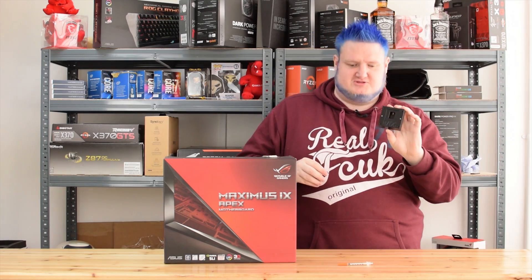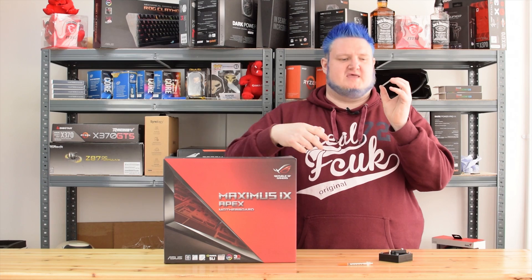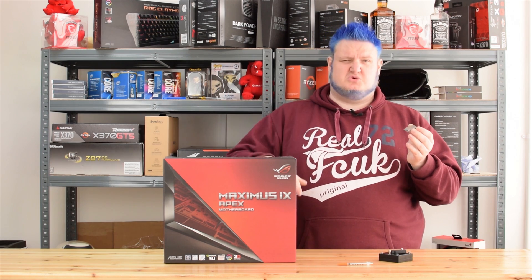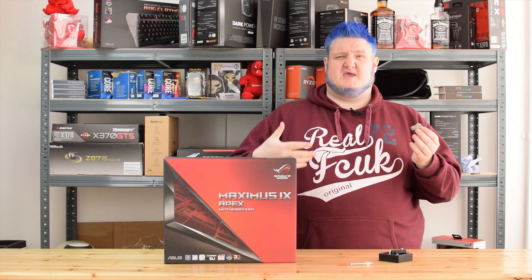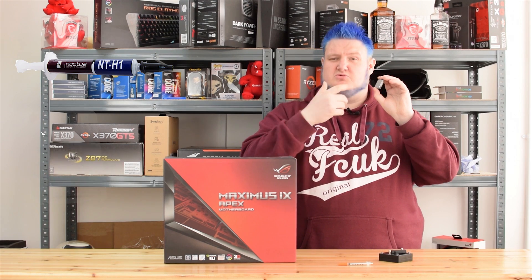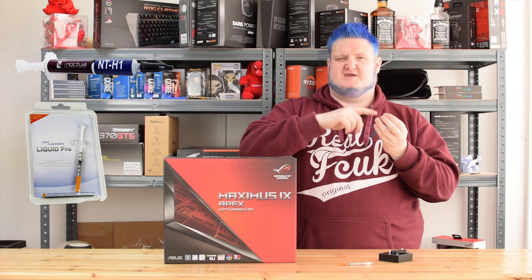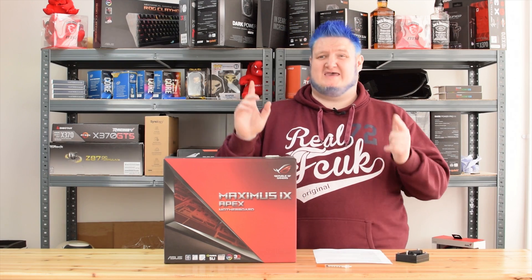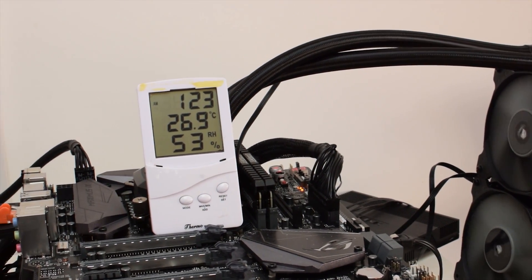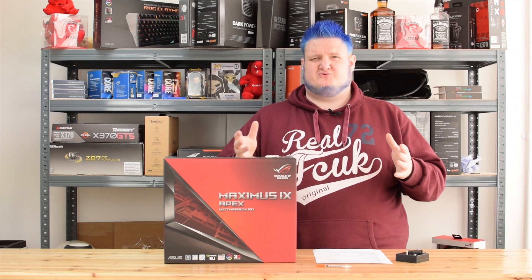The testing method: how we're going to test the difference between a CPU that has been delidded and non-delidded. The non-delidded CPU has had nothing done to it — all that's been applied between the cooler and the chip is Noctua NT-H1 thermal paste. On the delidded test, I removed the stock paste and put Coolab's Liquid Metal Pro between the die and the IHS, and then used Noctua NT-H1 on top. I ran Prime 95 with AVX enabled for five minutes for both tests — at stock with stock paste and after a delid — so the testing is pretty consistent throughout.